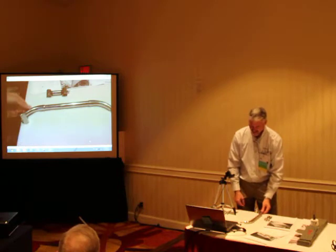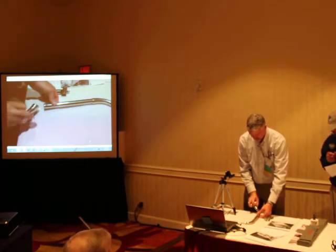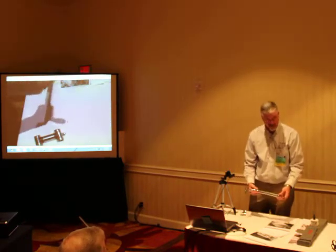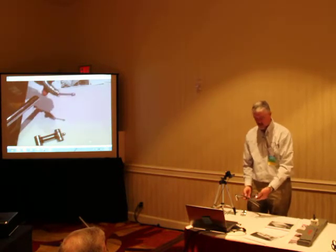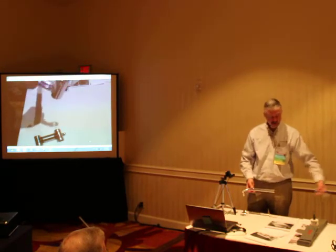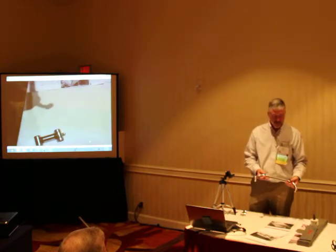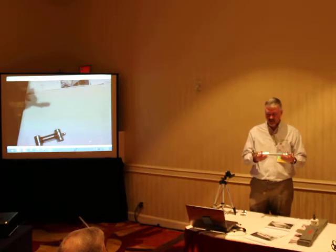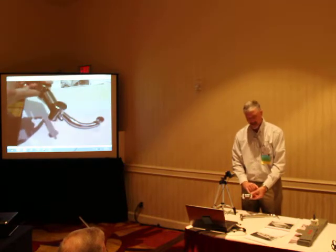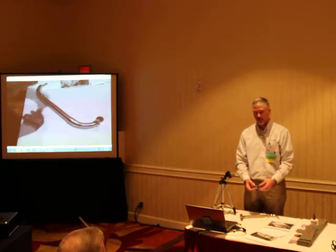Number 16 is the Dodger grab rails system, and there's actually two different parts here. Keith will explain. These look like just some ends that were custom made, I believe. They're tapered. They have a 1/4-20 or a metric bolt on the end, and you simply provide your own tubing in the center. You can make it as long or short as you need. And then they can also be crowned to match the back leg of the Dodger frame. Saves you from having to order a specific size. And then there's some nice little plastic concave fittings that go into the end of the tube, and they mate up to the Dodger handrail and also to the Dodger frame itself.